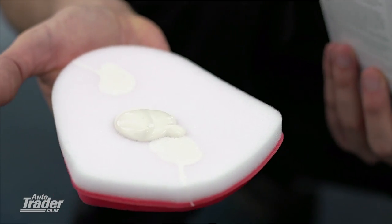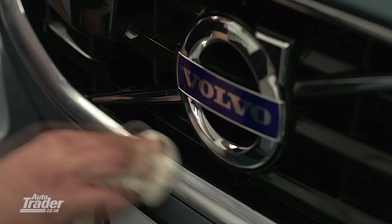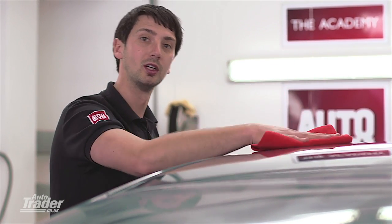Polishing is the second step because it's going to bring the shine back to the car. I'm going to use super resin polish and a Perfect Palm. The Perfect Palm fits nicely into the palm of your hand to stop you getting cramp as you're using it, and also gets the right amount of polish onto the car. I'm polishing using overlapping circles to make sure we get even coverage onto the paintwork. When you get to the edge, do a straight line rather than going over it — that way you won't put any polish into the cracks. It's worth spending extra attention on the bonnet, roof and tailgate, the flat panels, as they give you the maximum reflection and are the most visual areas on the car. For the chrome trim, I'm going to use a soft cloth to remove any water spotting or tarnished areas — it can also be applied on top of the headlights. Once the whole car is covered in polish, come back round to where you started, and as long as it's dry to a haze and you flick it and it goes straight through, it's ready to come off. You can also polish the chrome around the windows using a soft microfibre cloth with small circles. A lot of people think polishing a car can be difficult, but by using a good quality polish and a good quality microfibre cloth, it makes the job a lot easier.